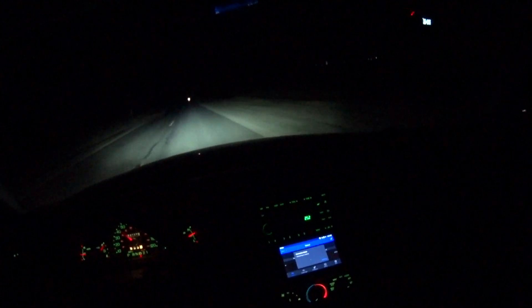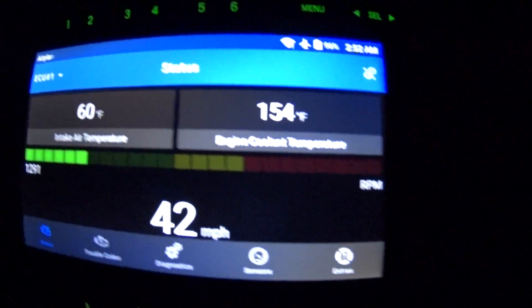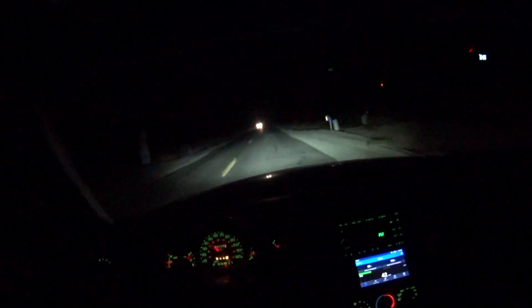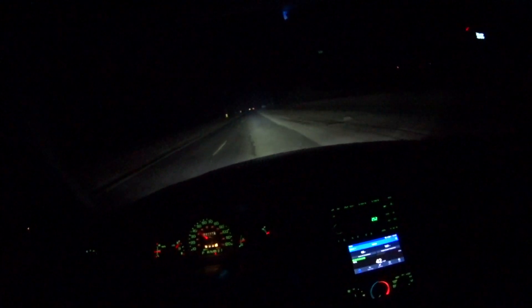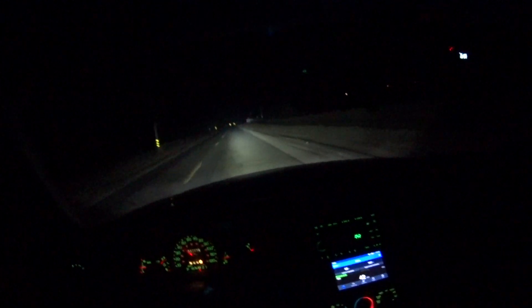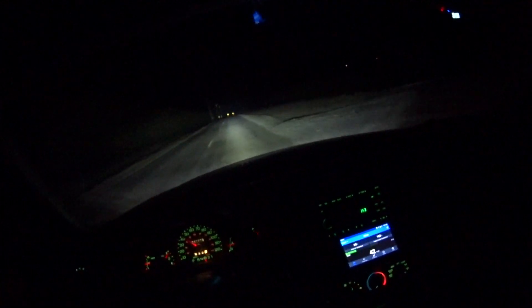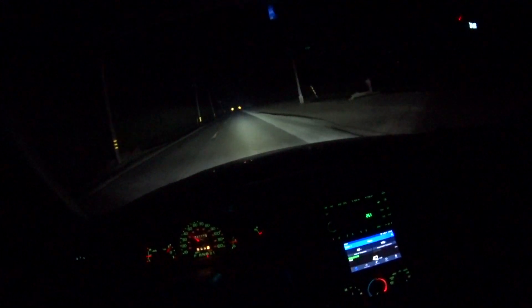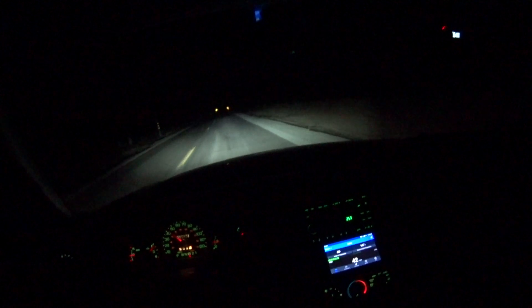Okay, we're connected. The engine coolant temperature is already up to 154 degrees, so we're almost at that 170-degree threshold. Back to what I was talking about with the smog check — they're going to check the PCM and the OBD II monitors. Usually you're allowed to pass with one monitor not done, but I like to make 100% sure that all monitors are run to decrease any chances of a surprise at the smog inspection office. Now it says engine coolant temp is 165 — we're almost at 170.